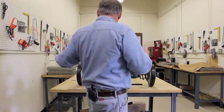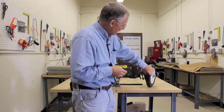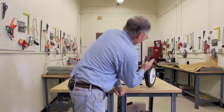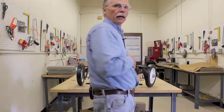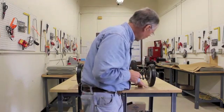There's always a best balance and you have to find it. The one crew chief rule of thumb that should absolutely always be followed is: when the tire is hard over and load is transferred into it, is it vertical to the surface of the track? If it's tilted, that's not good. Dynamically, the tire and wheel should be as vertical as possible to put down the maximum symmetrical contact patch on the track. And that, ladies and gentlemen, is one of the main secrets. So: kingpin inclination, scrub radius — and now we're about to take on caster.